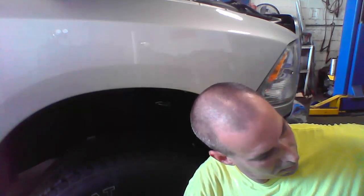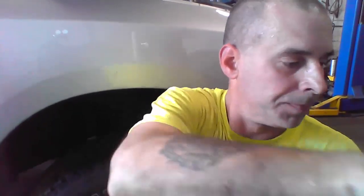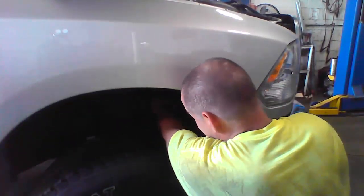Now I'm going to tilt it sideways. Reason why I'm tilting it sideways, I can see how much oil I put in there. Roughly, it's going to be a cup or so, because it goes sideways. Yep, that's about right. Don't forget to lubricate the seal. The filter goes in sideways.